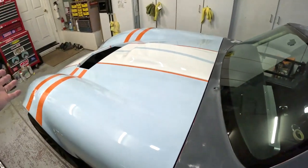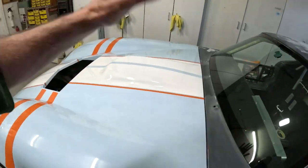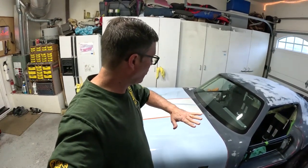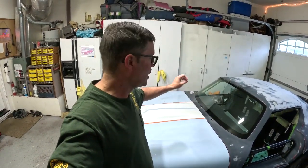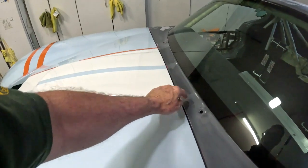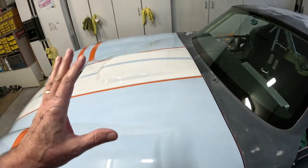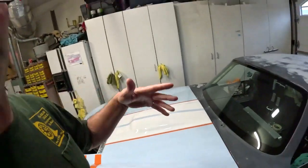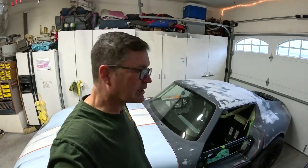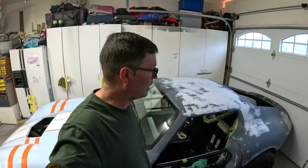Rolling means I don't have to tape off the edges, drop the car, tape off the engine, or tape off the hood. I'm going to leave the hood on this time — I'll lift it up when I paint. Once I get the white stripes laid out, I can drop the hood and make sure my lines are perfect because the hood is right back where it needs to be. Then I'll bag the whole hood to keep overspray off. It'll probably be a five-to-eight hour job just taping everything off.